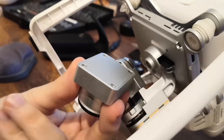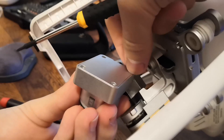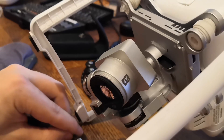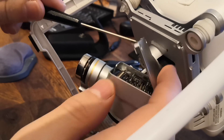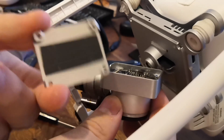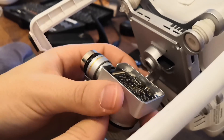To start taking apart the camera, you do have to remove 4 T6 Torx screws from the back. When you're doing this for the first time, the backplate may be a bit stuck. If you can't take it out with your fingers, you can pry it open with very little force from the little hole in the back. The reason it may be stuck is because there is a thermal pad that adheres to the components it is cooling on the circuit board.